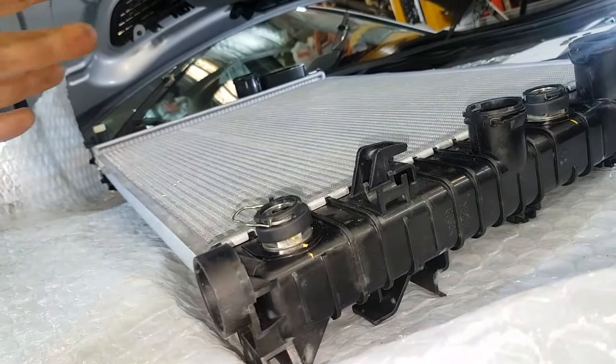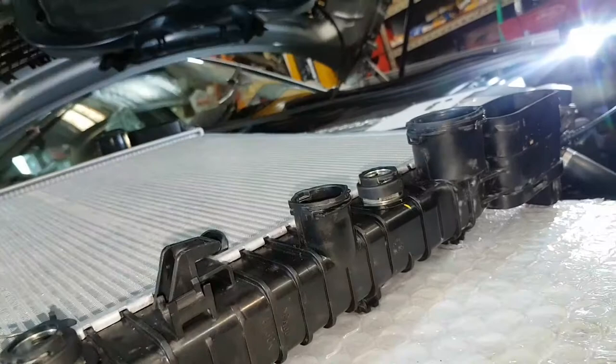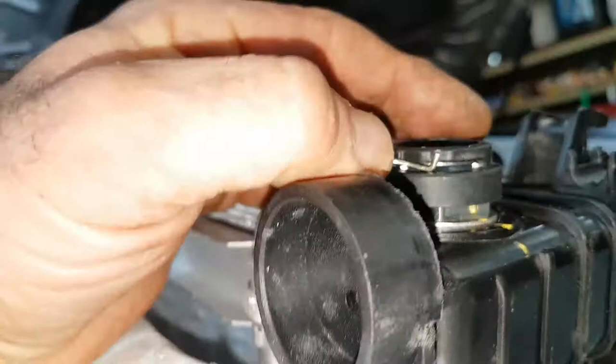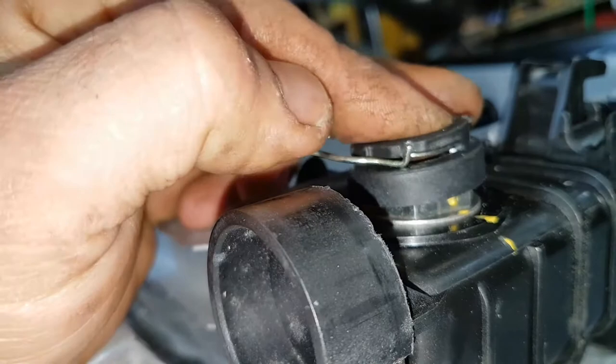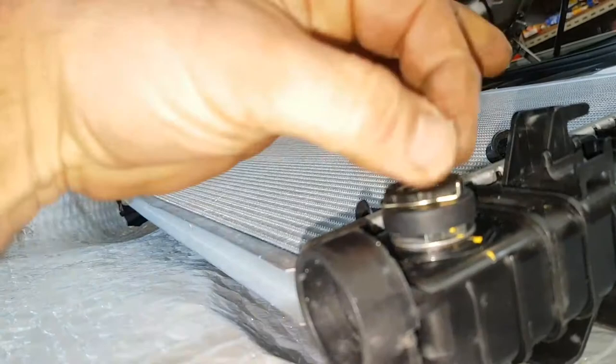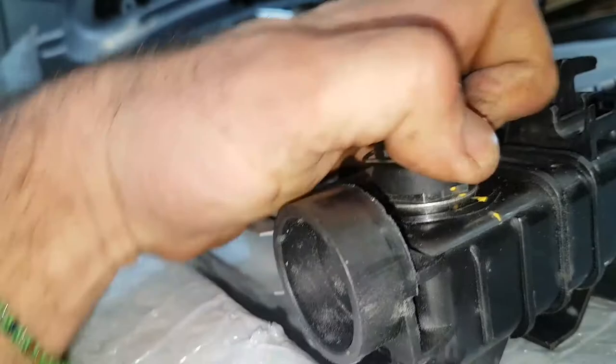Something very simple from the factory has also got built into it a possibility of error. The BMWs are the same — I've had endless cases over the years where the top hose blows off the little bottle. It can happen months after you do the job because of a missed seating in this area. Now with this clip system — you put it on, and it can feel like it's on. When the hose is in there it has the capacity to derail.